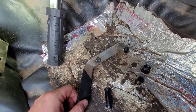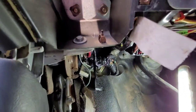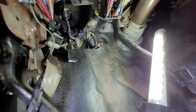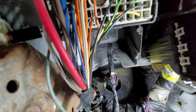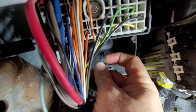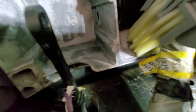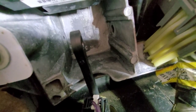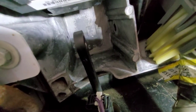Let's see if I can get up here so you can see kind of where they go. You can see where the clutch master cylinder comes in right here, and it'll actually attach to the pedal. There's also a clip that goes on right here that actually attaches it to the pedal. But the pedal itself goes all the way up in there. If you look close, you can see there's a hole there, and then there's another one on the other side — that's where those bushings actually slide into, and that's where your pedal will pivot.